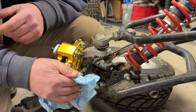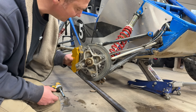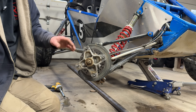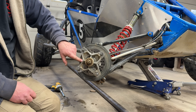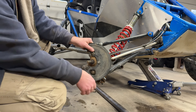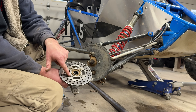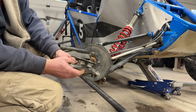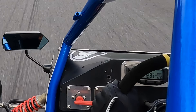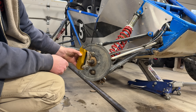Get it nice and clean and check for leaks. I just found the only con of these: you have to trim your dust shield to make them fit. So I've got to pull this and trim it — that sucks, but you should be changing your rotors anyway. I also have my speed sensor running through my dust shield. The Trail Tech I use is pretty slick — you just replace one of your rotor bolts with a magnet bolt, hook up the other side, gap it a bit, and every time it comes around it picks up a signal. I'll just figure out how much I need to trim.